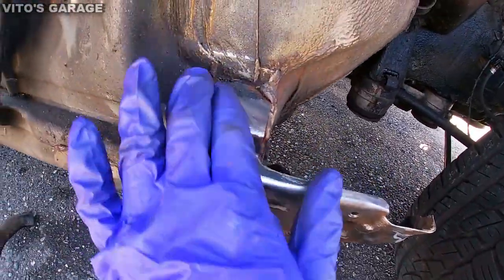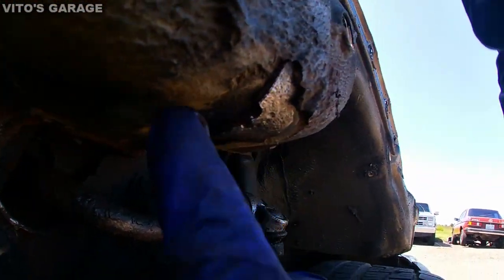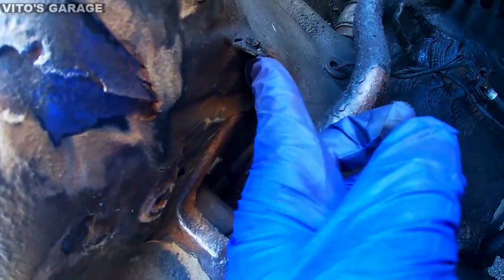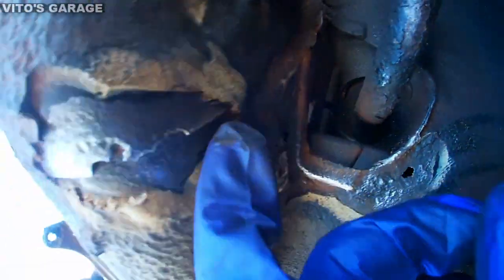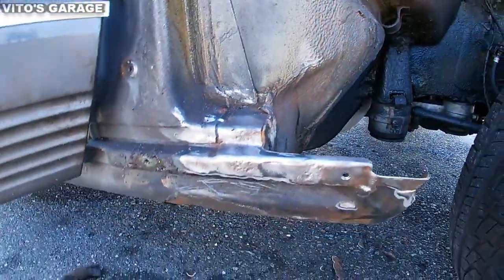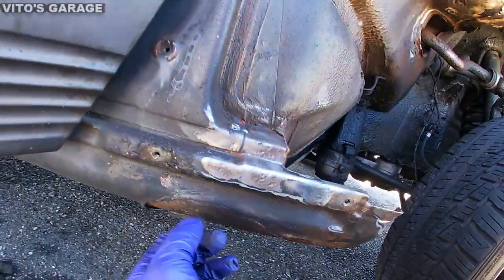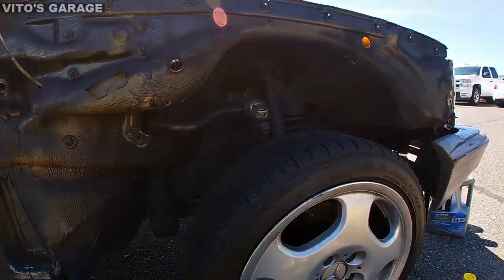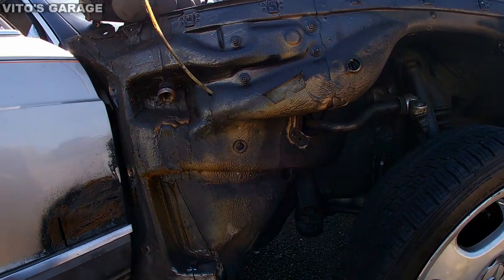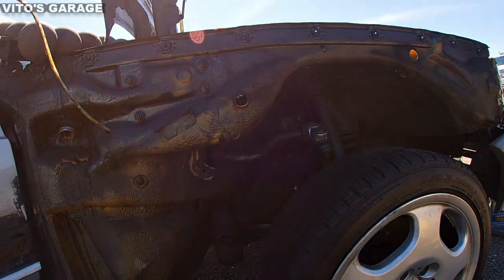This is all getting cleaned up. I also discovered some more issues — I had to peel all that stuff off and clean it up, and there's more rust right there. There's a small hole right there — this is not too horrible — and another small hole there as well. The biggest thing is the jack point is gone and another area is starting to go as well. My new fender is drying right now — I put a lot of paint on the inside — so I'm waiting and in the meantime I'll keep working on this.